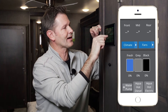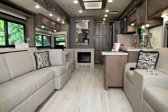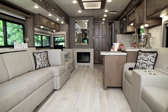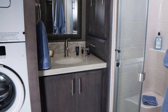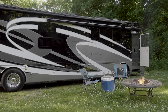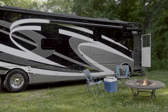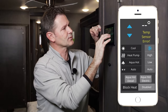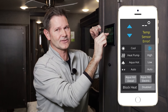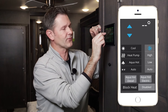Getting into your Aqua Hot 250D — your diesel burner is going to be your main source of power. Aqua Hot diesel, you turn it on there; Aqua Hot electric, you turn it on there. This is going to be your furnace and your hot water for showers and laundry. It runs off your diesel tank and when you're camping it runs off 12 volts DC. When you're plugged into shore power, the 250D is going to use a 110-volt electric element, and this is where you turn that on.